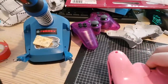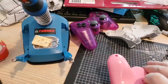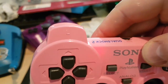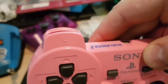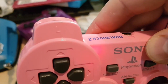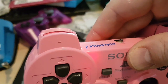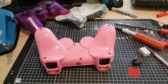This is very rough and I'm doing it with one hand, but if I get it together enough to show you the front — if I press the start button, you see it lights up? That is the finding light. It used to be the green light, now it's a red light. But I've also got the power light shining through the plastic, so I might either desolder that or cover it up with electrical tape, because I want that one to flash and then go solid, but that one I don't want shining through the plastic — I just think it looks a little bit ugly.